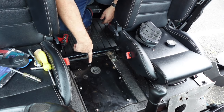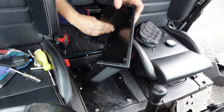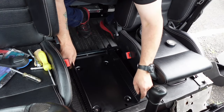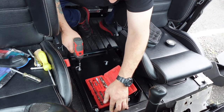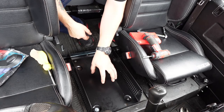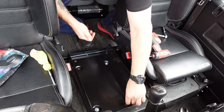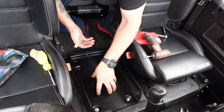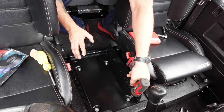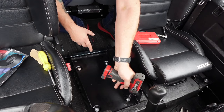We've now got our plate solid. We're going to have to break this little tab off here — that was what was holding the electrical connector. If we offer our plate up, you've got this angled front piece and that is to clear the transfer lever. We'll put that in that way around and we're lucky because the holes all line up. Although these holes are in the designated position for a genuine Land Rover cubby box — if you've got an aftermarket box with different hole positions, you're going to have to fettle with it a little bit. But we're lucky because our holes are in the right place.